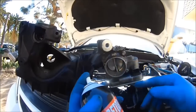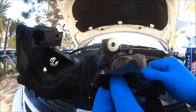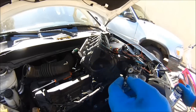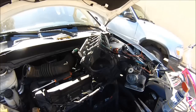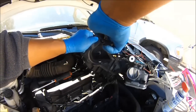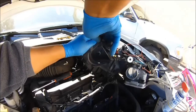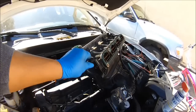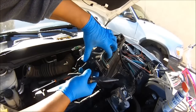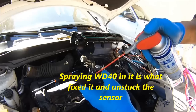Now clean the throttle body and throttle plate before you put it back on. Get your carburetor spray, just spray it up like that. Get your rags and move the throttle back. Put a little WD-40 on the O-ring. Put that in there like that, line it up. Pop that in — now it's into the groove with the runners. It controls the runners. Put a little WD-40 around here, let it sink in, move it a little bit so it can move freely.